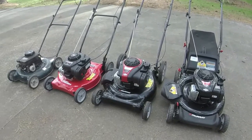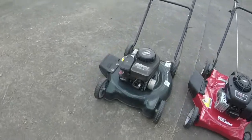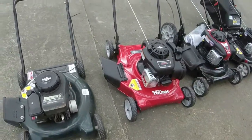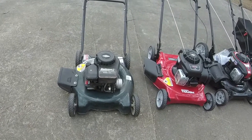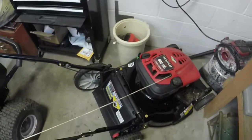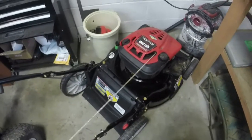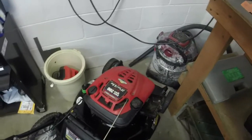My recommendation: if you can find one of these classic type engines, the mowers might have a little bit of age on them, but as a regular consumer you'll be much better off and much happier with that type of engine. Let me get the Quantum comparison. I don't have the best Quantum-to-overhead-valve comparison, but I have both engines. If you have a little bit of know-how and can find a good Quantum or even a classic flathead engine, these things run forever. You don't see base plates breaking on them and you don't really see shafts bending on them either.